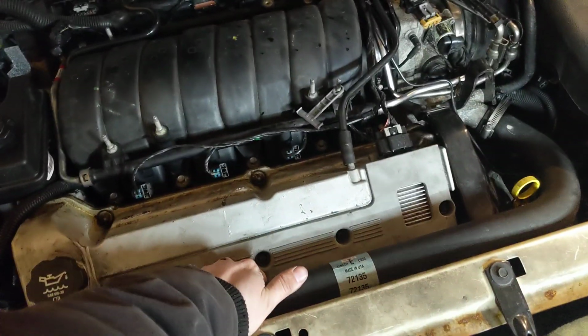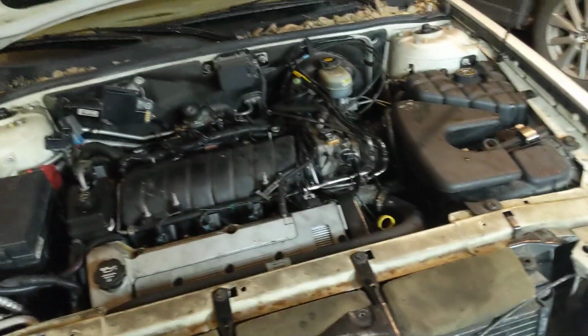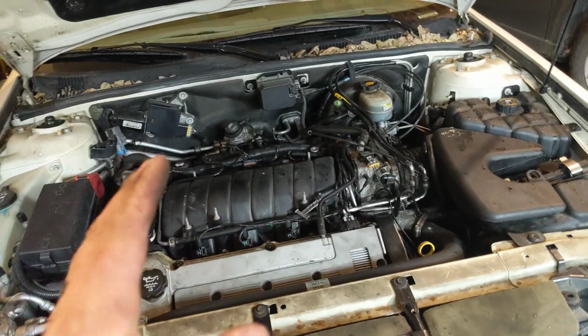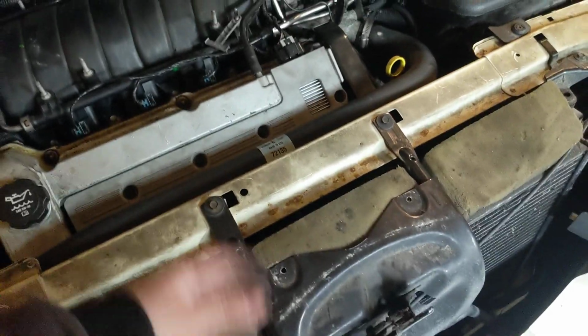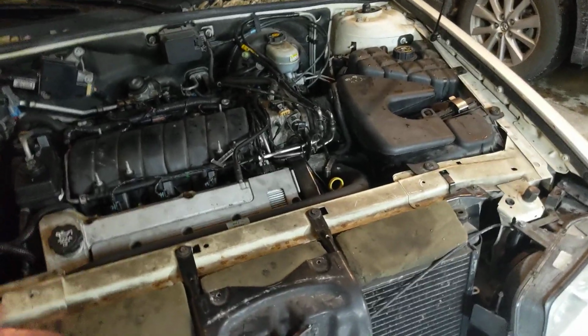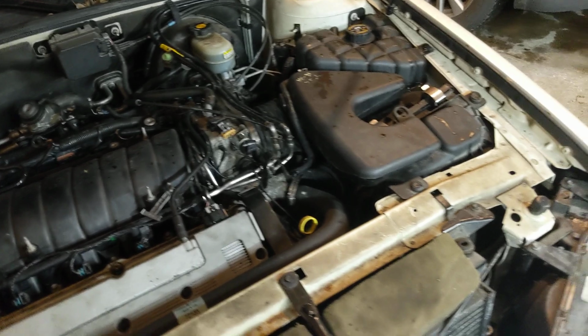This is just barely warm on the very bottom, but it went up 1 notch. But before, it was up 1 notch, and then it was slowly climbing higher. This one went up 1 notch, stayed there. The cooling fans were going when I came back, which is a good sign. That means they're working and that they're trying to cool the system. There's just not enough fluid making its way through. So no squeaks or nothing, and it sounds a lot better.